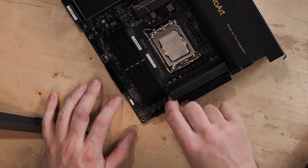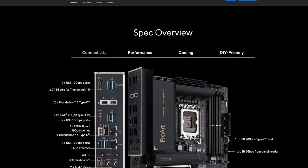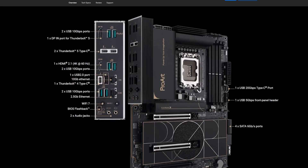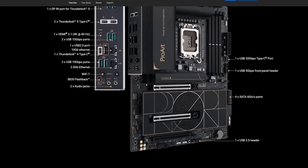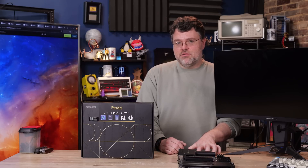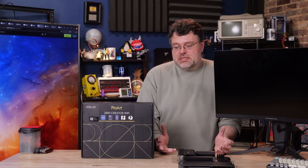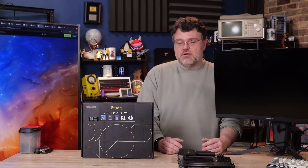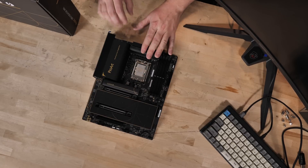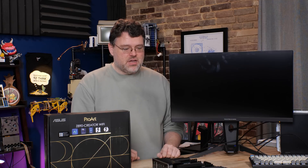At the top edge, we've got three 4-pin fan headers with little rubber protector things, and two 8-pin connectors for CPU power. Even though this is a Z890 motherboard and the less expensive B860 chipset has launched, there are still a lot of reasons to buy this board — mainly if you need two slots with PCIe Gen 5 connectivity, onboard 10-gigabit, or a premium build. This motherboard pairs really well with the Core Ultra 9 or Core Ultra 7. The VRM is overbuilt and there is a substantial heat sink on this platform.